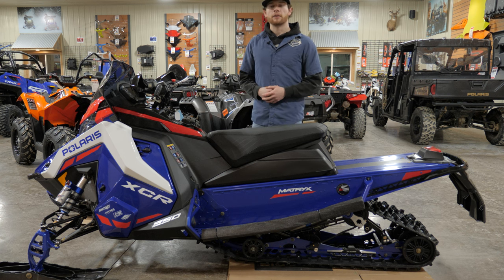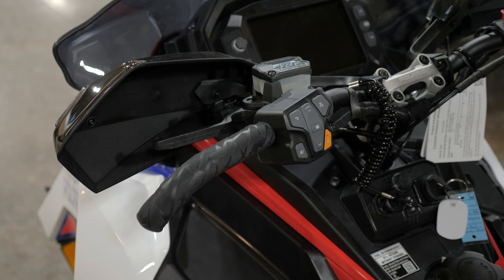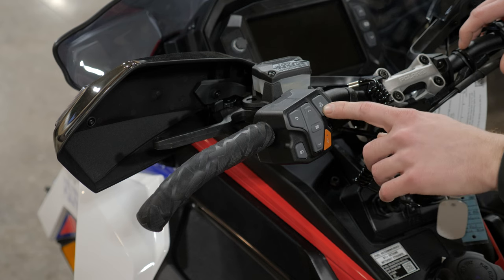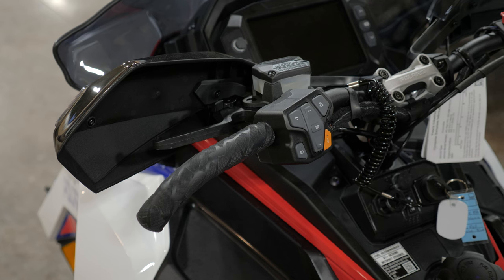On the left-hand control, this up-down arrow and middle button controls everything on our 7S Ride Command screen — I have another video on our YouTube channel covering that in detail. High and low beam is right here, and the back button also controls the screen. The heated hand warmers and thumb warmer are all combined in one simple switch with high, medium, and low settings. When going into reverse, let the sled warm up — I recommend around 60 degrees — before you push it into reverse. The sled will die, start back up, and everything works in reverse. To go forward again, click the orange button and everything works forward again.